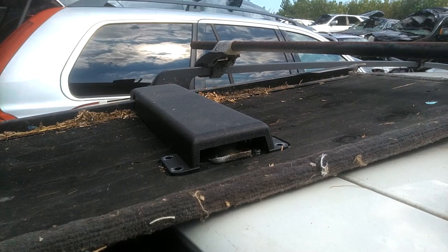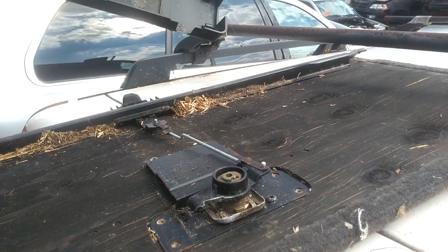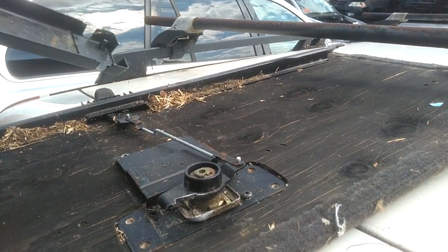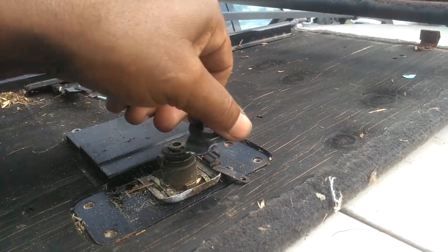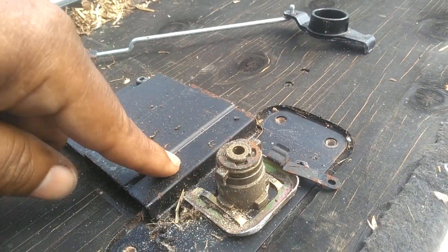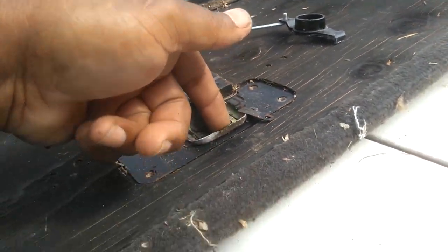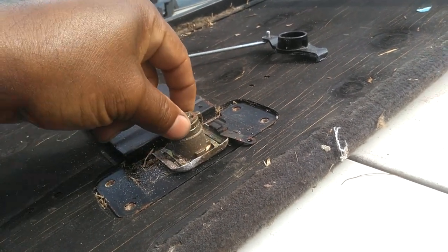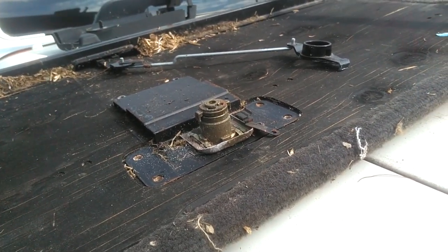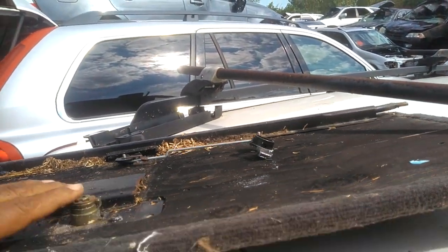Two minutes has gone by. Getting this keyhole out of the floor panel on the 850 — you take these four screws off here, lift that up, slide it forward. Actually this end just pops up. Now you undo this little latch thing here and that lifts up and off. Looks like prying this little clip out here is what will get it loose. So I'll take a pry bar and pry this piece this way, and that will release it — it'll fall out and I'll have it to take with me. I slid this off; now this should come out. There it is folks — I got it.